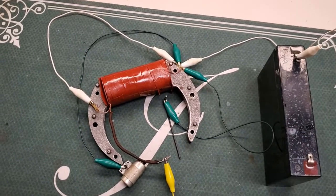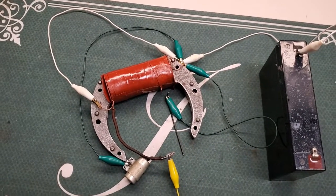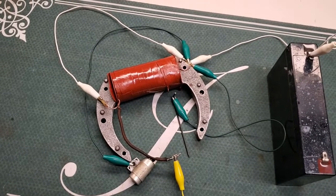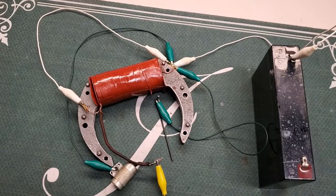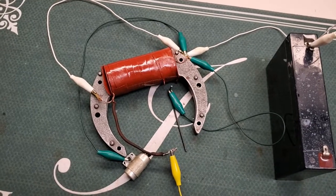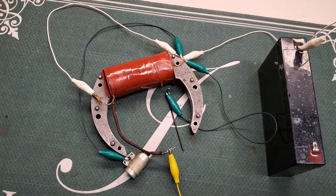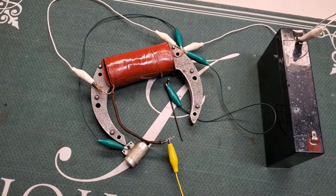I think what I'm going to do is I have two other coils that I have for my Briggs Model Z project and that original Briggs PB coil. I think I'm going to do a video and we're going to tear one down, just to see, because this is two of them now that I was able to fix. On my Briggs FH coil, the winding, the small little fine wire, had corrosion on it and rotted through, and I was able to fix that one.